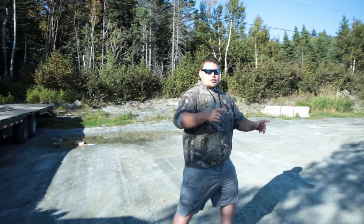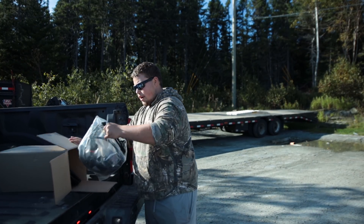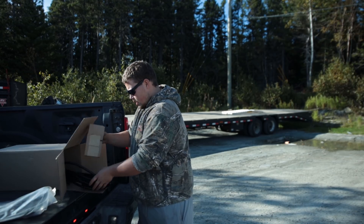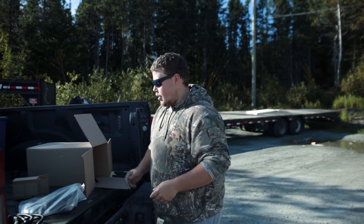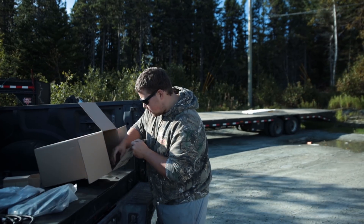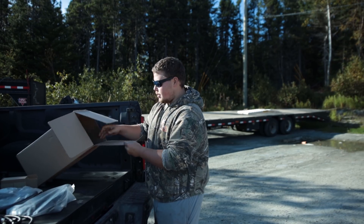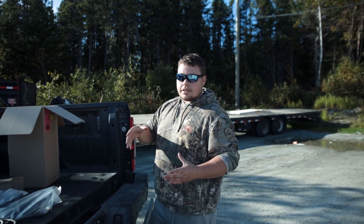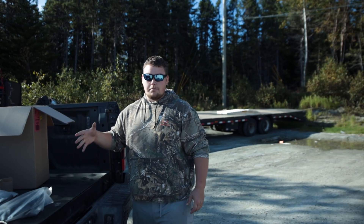Let's go get the box of goodies that the truck came with and we'll see all the sensors and wiring for it. So in this box, this is what we need for the Pro Trailer Backup Assist. This cable — I have no idea what it's for, but I'm guessing it's for the camera or TPMS. A bunch of zip ties and everything. This is the TPMS receiver and the TPMS sensors. Now, I can't use the TPMS sensors because I have eight wheels and it only supports six, and they're commercial — the steel inside the tires doesn't let the TPMS sensors send the signal out. Same thing with the F450s — they don't have TPMS sensors because of the steel-belted tires.